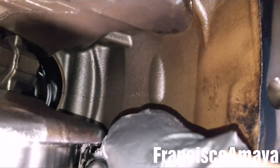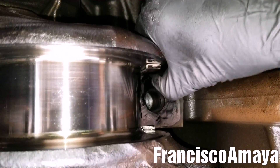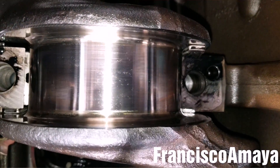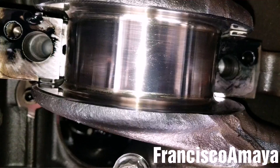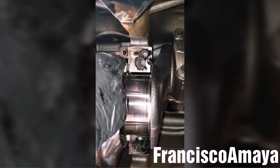The rear one is the easiest to remove — it's coming out as you can see. The front one retains the crankshaft from moving to the back, so don't remove the front one until you have the new one ready to install. If you remove it, the crankshaft can move back and damage the rear or front main seal. The rear one you can remove at any time with no problems. All the top bearings are now removed except for the thrust bearing — don't remove that one yet.